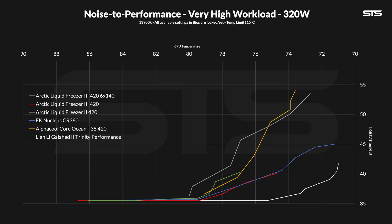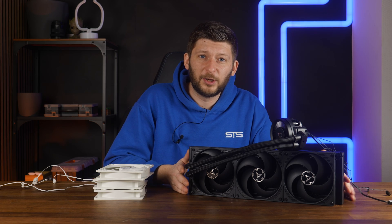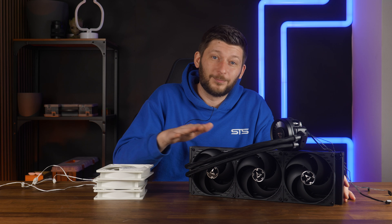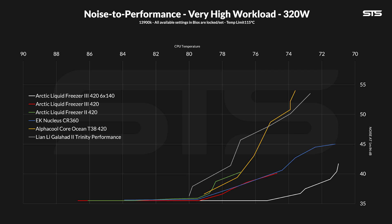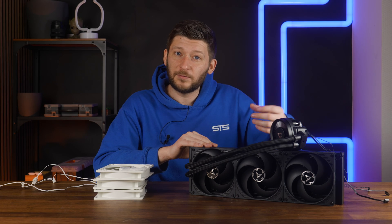There is not really more you can squeeze out of it. And the same type of line we see at the end of my personal monster: the last measuring point barely made a dent in temperature but made the thing a whole lot louder. Meaning the combo of radiator, water block, pump — whatever — is done. Whereas the line of the original LF3 ends at a nice angle, equally changing in temps and noise if you touch the fan speed.